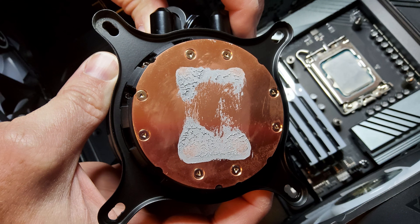This doesn't seem like it needs a washer mod, but I do want to show you what the washer mod is. You'd basically see an hourglass pattern, meaning the cold plate for the AIO isn't fully connecting with the IHS of the CPU. What we do is install washers, which creates more pressure. The bowing that Intel says doesn't exist actually changes contact — the IHS gets more contact from the cold plate, and this can have a drastic effect on overall temperature.